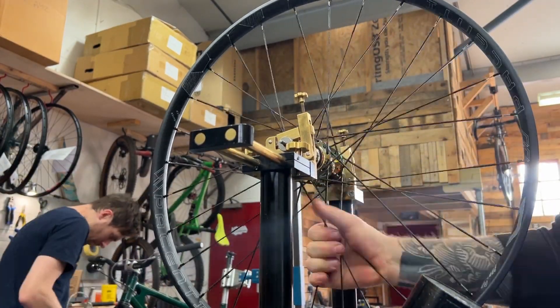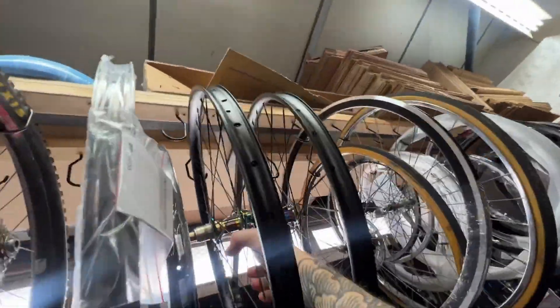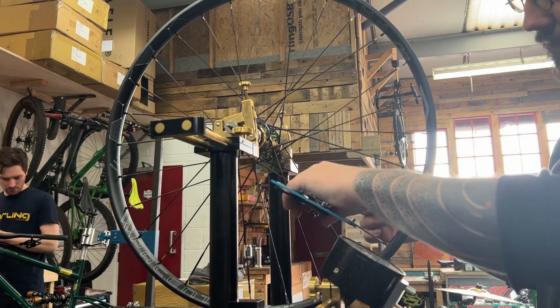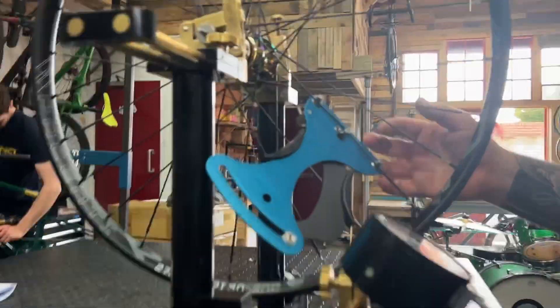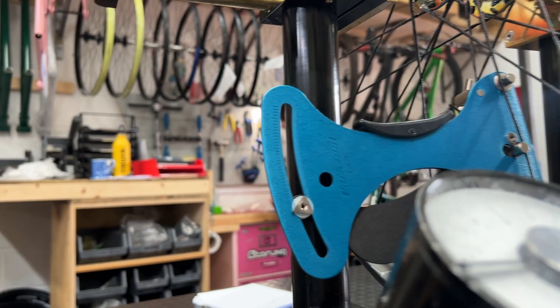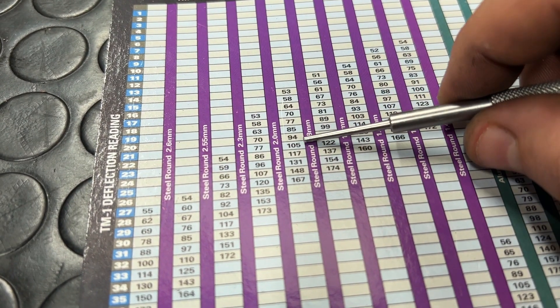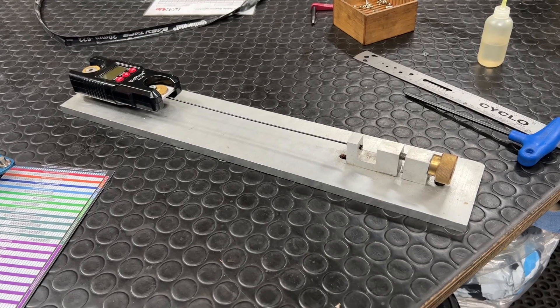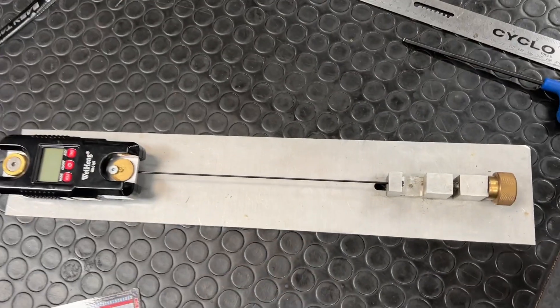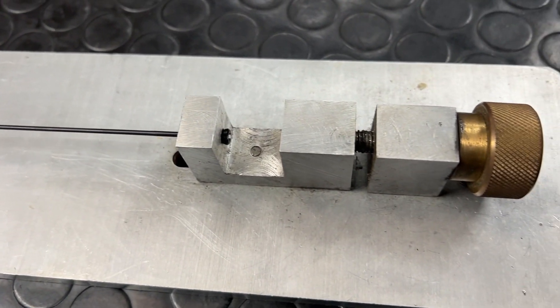You've got to allow them to rest. As the spokes elongate, tension drops, and you bring it back up. It's worthwhile noting that I've already seen systems online — building machines specifically to stretch and pre-tension these spokes before they get installed — pretty advanced stuff. But how do we know what tension we're at? Bird suggests building to about 100 kilos of force, but I want a more accurate way of measuring that. Enter the spoke tensionometer calibration device.